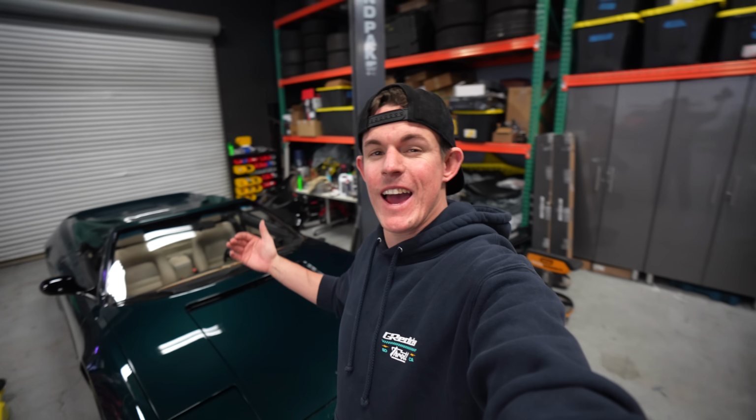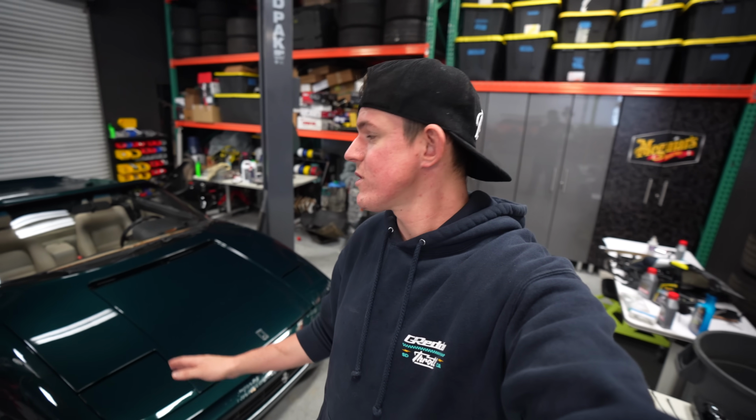Ricky and I just finished our test drive with the Ferrari, and it turns out we might actually have a bigger problem on our hands as far as the transmission goes than we initially thought. We changed the fluid, which was absolutely destroyed, put some fresh new fluid in it, and it didn't really seem to do a whole lot. Now, reading owner's manuals on these cars, crashing the gearboxes and second gear grinds, third gear grinds is very common for these when cold. I don't think we've driven this car nearly long enough to get the transmission up to temperature. Up and down the cul-de-sac once or twice is not gonna get this transmission up to temp. It could be a totally normal thing, I just think we need to drive the car more and find out.